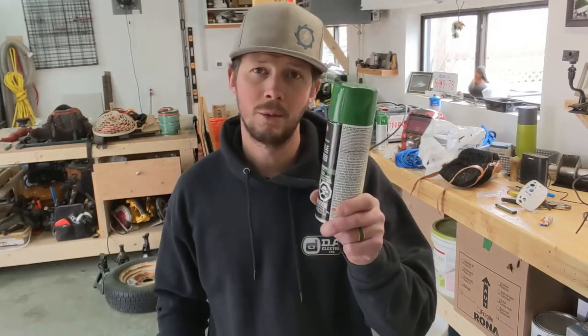Now that it's primed and dried, we're going to start painting. Same procedure with the paint as with the primer — light coats, even passes, and just stick with your coating times on the can. Many light coats are better than one heavy coat; it just doesn't dry as well. Follow your instructions on the can. We've got the trailer outside — it's a little breezy, which is going to make painting a little hard, but down here in southern Alberta we don't have much choice. It's always windy here. Let's get going — we're going green.